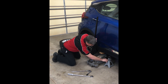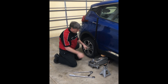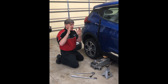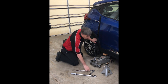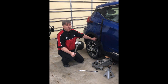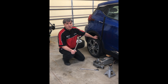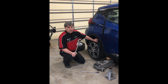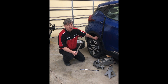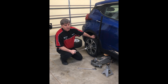I can take out my jack and safety jack stand, and lower it down just so it's touching — not taking all the weight off. The reason is if the tire isn't completely tight and wants to walk a little, I'm not putting as much stress on it, so when I go to tighten it I'm doing it more accurately. When you tighten your lug nuts, it's important that you use a torque wrench. If you're out on the highway with a flat tire, you do what you can — snug up the wheels, get them good and tight, get home, and if you have a torque wrench go back over them and re-torque. It's very important. If you're going to do this for many years, invest in a torque wrench.